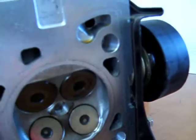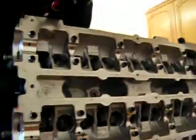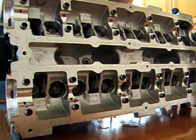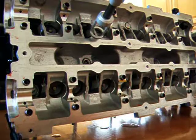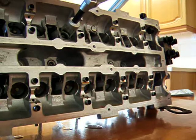So I will be removing this valve along with the valve springs on the other side. I will take my valve spring compressor and put this part on the underside there. I will just have to move this camera now. There, you see what I am doing. So I will take my valve spring compressor and put the underside bit on the valve. I will take the collet release and put it over the top half. As you can see, the valve end is just coming from the top half.